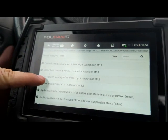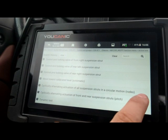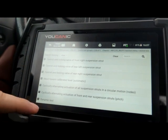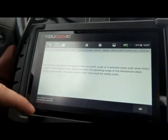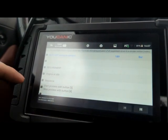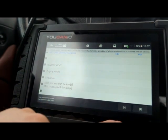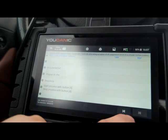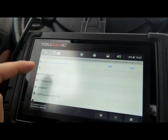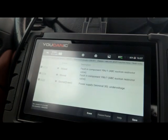In the active test menu, you have a few options. You can even raise the vehicle, and here you can do the rodeo test. This will cycle all the suspension struts. You can also run a dynamic test. Select rodeo and it will warn you to be careful because there can be injuries. You can see the ABC pump pressure. The engine needs to be at idle, then you can start the procedure by pressing button five and stop it with four. If the rodeo test does not start, go back to reading the codes — you might have a problem with the ABC pump not putting out enough pressure.